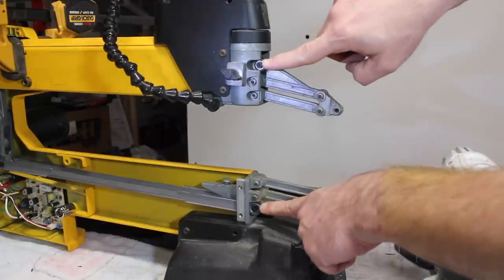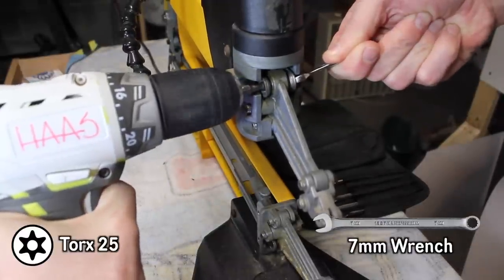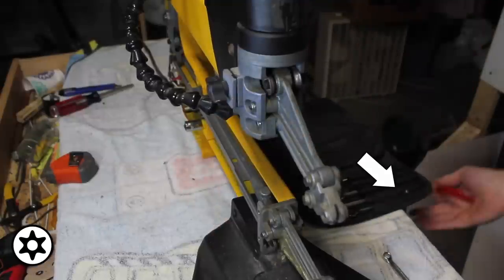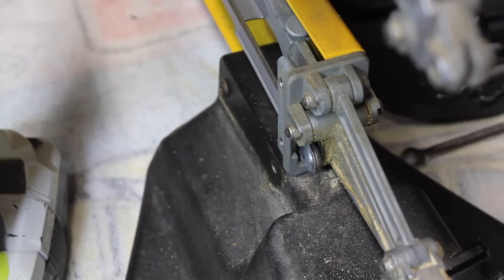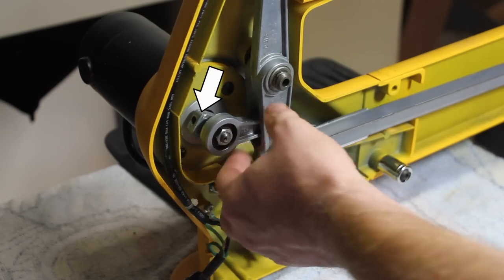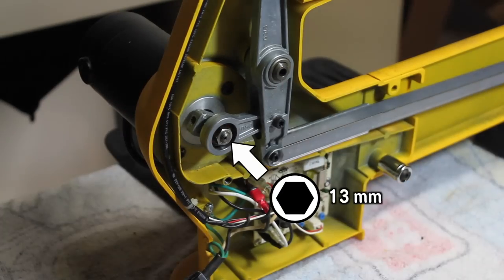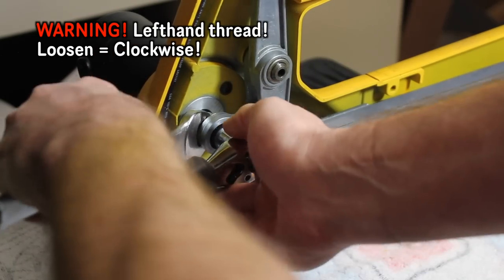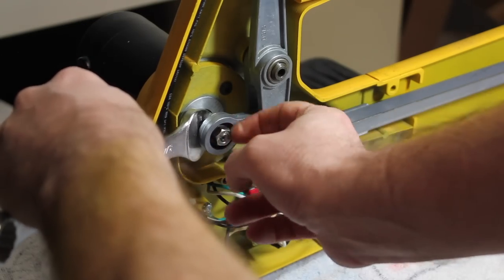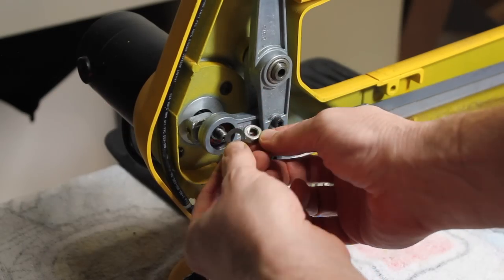Remove the nuts and bolts in these two areas to free the rocker arm. You'll need a very small 7mm wrench and a Torx 25. I almost lost one — my saw would have been useless without it. Get both of those out. Spin the motor shaft so the counterweight is in the 10 o'clock position and make sure it's seated on the frame — that'll make it go easier. This is left-hand thread; you must go clockwise to loosen it. Do not do the opposite — you'll ruin that motor. It's a $260 motor. Be sure to keep this very rare left-hand threaded nut safe.